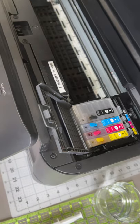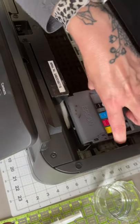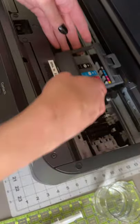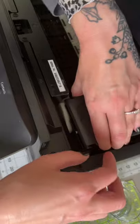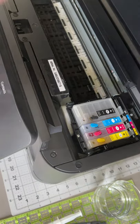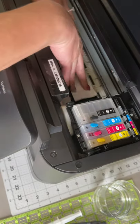So I'm going to prime the ink and see if that helps. Priming the ink has actually been my go-to in the past. You do the same thing where you say you're replacing the ink cartridges and then unplug it partway through so that you get access to it sliding. The problem is that this doesn't necessarily like to open all the way, so what I do is I just pop the door off.